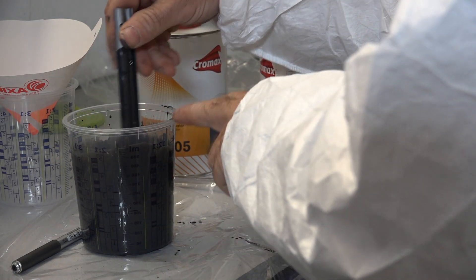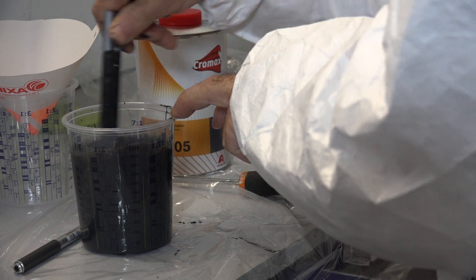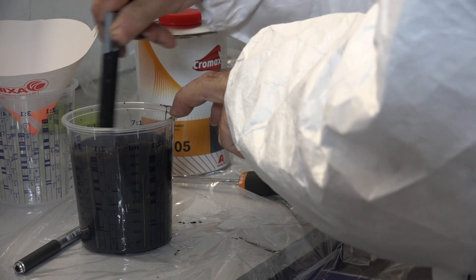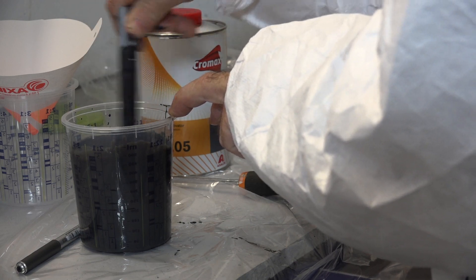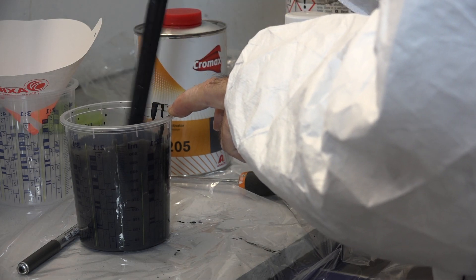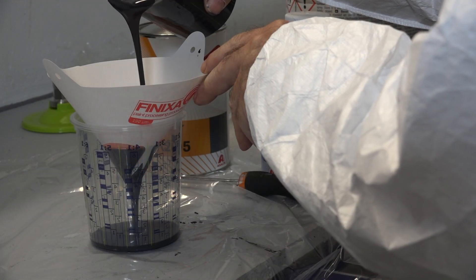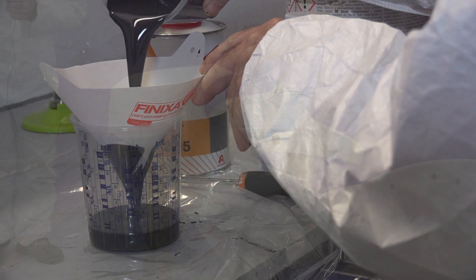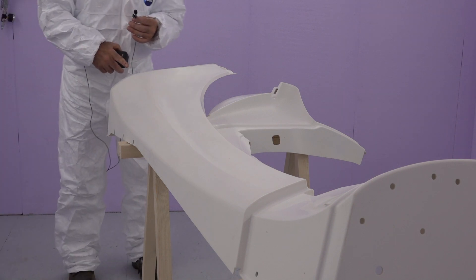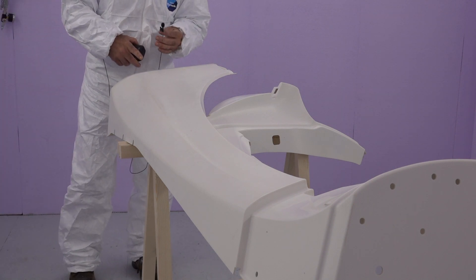You may have noticed I prepared the paint in a bucket without a filter. It's always better to stir and mix everything first, and then filter it. That's what I'm doing next — filtering into the final bucket. I'm now in the paint booth, I'll degrease it one more time and then tack rag it before painting.